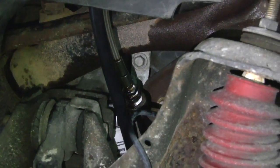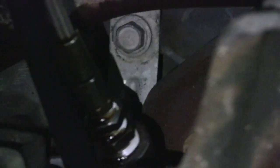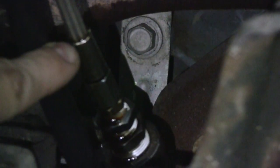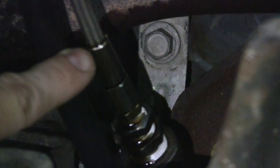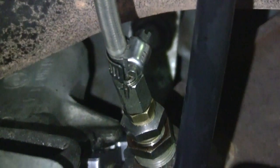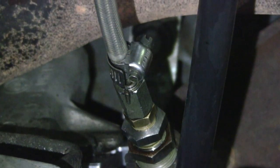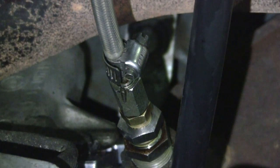We do have a slight oil leak here. I'm hoping it's just that I didn't tighten the flare fitting up enough. However, what I'm concerned about is that the oil I see is actually up at the line itself — I wonder if they sent me a bad line, which would be really annoying. I'll tighten it up a little bit and see if it has an effect; if not, I'll need to get a new line. Long story short: it was leaking at the crimp connection. To make a quick, easy, and free fix, all I did was cut the crimp connector off and replace it with a hose clamp. It's working just fine.